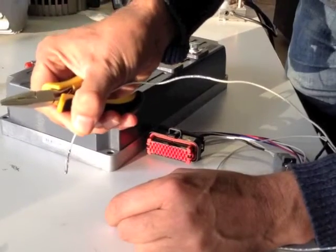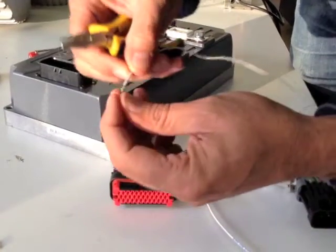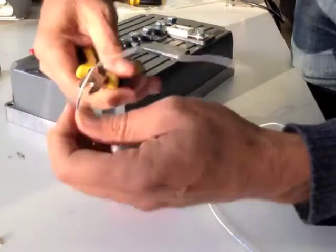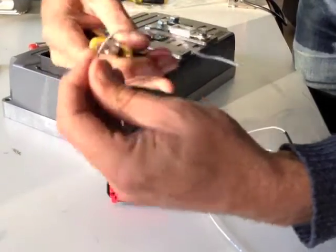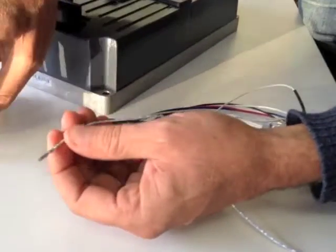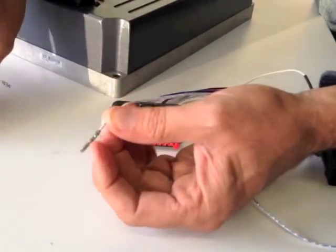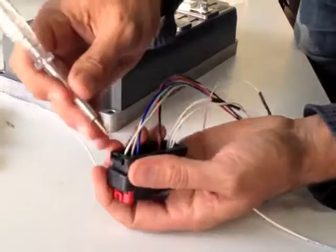You can see that's a little bit banana shaped. If I try and put that into the connector now it's not going to go in smoothly — the whole point is to make sure it slides in like butter. If it's a good crimp and it's straight, it'll slide in like butter. We just have to straighten it up so the whole thing is quite straight. You see that thin neck there? That actually gets gripped by the plastic — it's got some plastic tabs inside that grip right there. It's quite a clever mechanism but very intricate, well designed but not very intuitive.